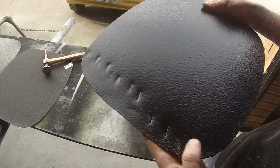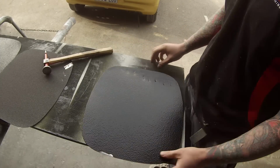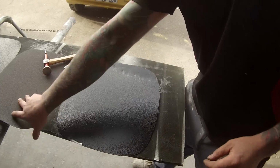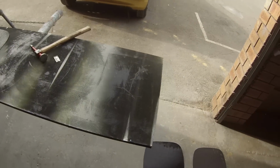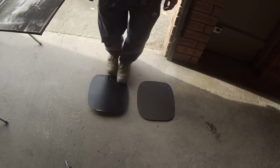So moving along, as you can see, I've started getting stuck into it, and it's barely budging. Just don't forget, these are just test panels, so I'm not too worried, but they did stick to aluminium. I would have preferred to put some kind of an etch primer or an epoxy primer, which would be ideal to get the best adhesion first.